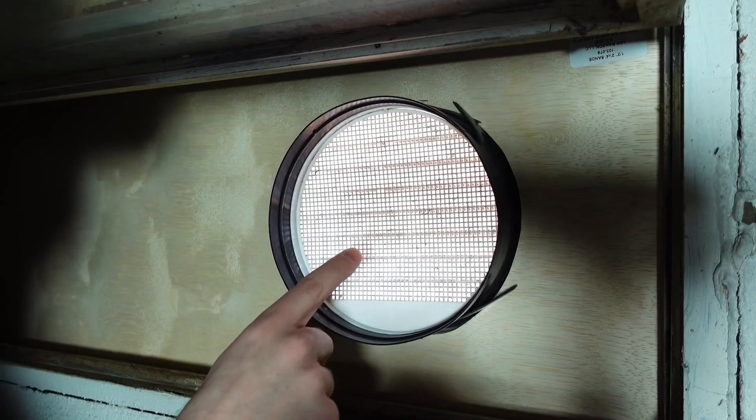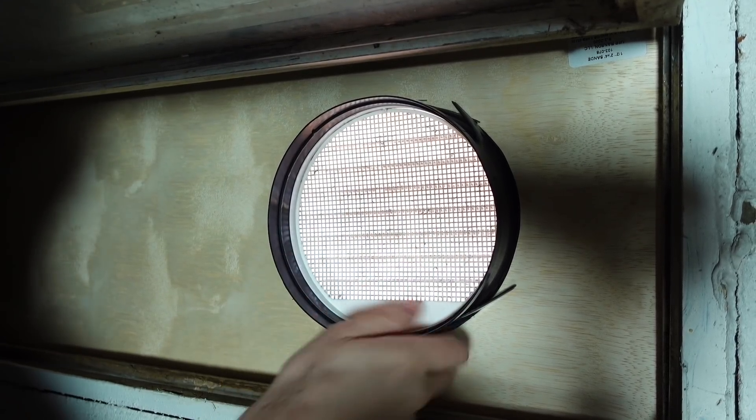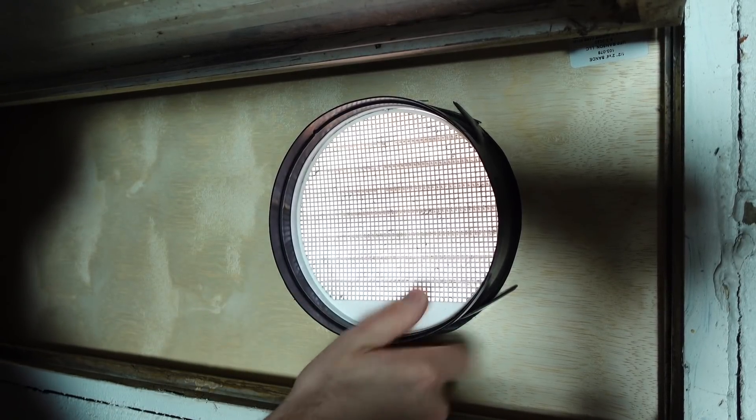All right, moving on. There's the outside vent — it's got like an insect screen in it. I just got a piece of plywood up here. I'll show you it on the outside once I get it all hooked up, and I'll leave links to everything I use in the description below in case you want to do this — especially a lot of you new miners out there. When it comes summertime, it is not fun to have all that heat coming back into your house. So let me get the ducting hooked up here, turn the inline fan back on, we'll go outside to see what it looks like, and I'll show you how much air is getting pushed out of this tent. Then we'll come back inside and get the tent all figured out so those GPU temps are in a really good spot.